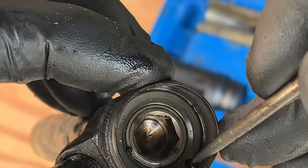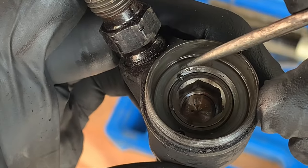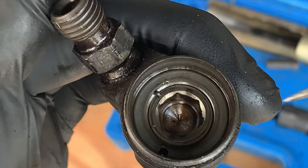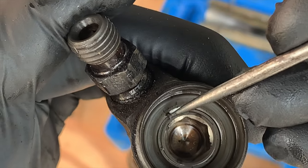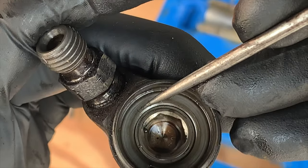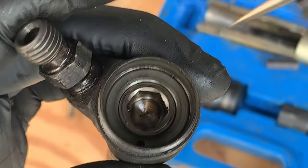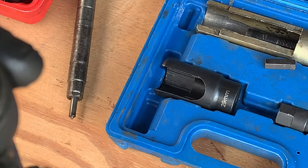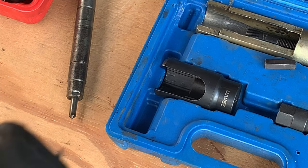The cylinder has a cup in it, so it can balance on top of that ball. And the tack, the flat point of the tack, if you will, is shaped kind of like a thumbtack. That thumbtack would push down on top of that cylinder. If you lose any of those tiny parts, forget about it. Your injector is not rebuildable.